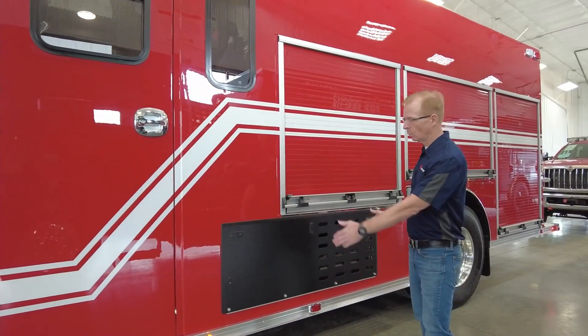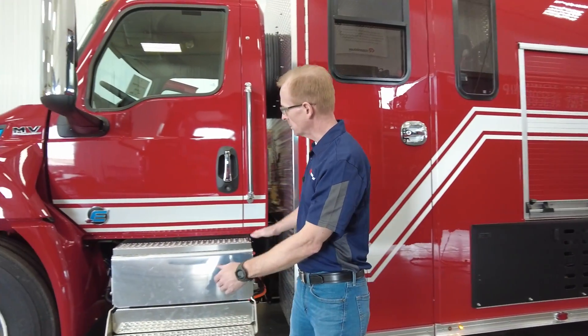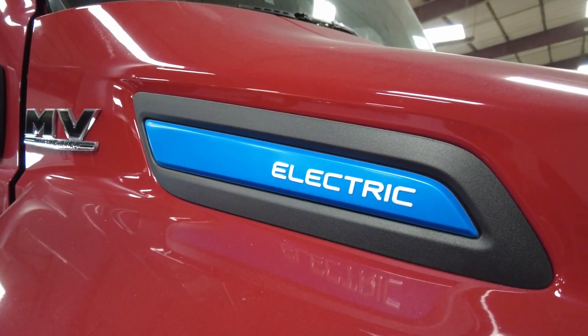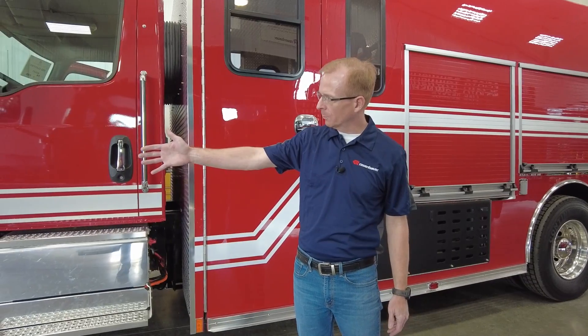There are three main battery packs. One stack is located about here, one stack is approximately here, and the other stack is located directly underneath the chassis cab, for a total of about 600 volts — approximately 210 kilowatt hours altogether. Range for the vehicle is purported by IH to be about 135 miles. They're located inside the frame rail and low, so the center of gravity is low, and they're easy to service. They're contained in a simple saddle — if they ever need to be worked on or replaced, they just drop right out the bottom. Also, because they're centrally placed, they're away from potentially being damaged in the event of a strike from either the front or the rear.